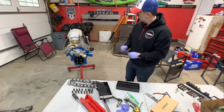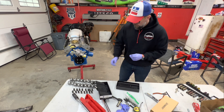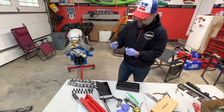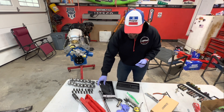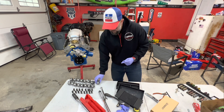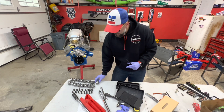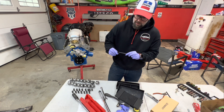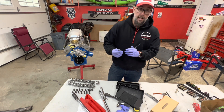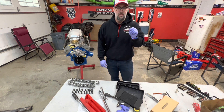That should be good to go. I'm going to go ahead and start dropping these in. I'll take a little bit of oil and dab some on the ends. Same for the roller rockers — I'll put some oil on the roller and around all the contact surfaces. I already got all the rockers ready to go, making sure this portion is facing up the right way. I'm going to go ahead and back out the little Allen head on all these nuts so when I go to tighten them it's not interfering.